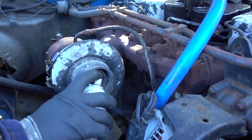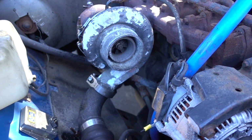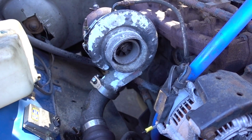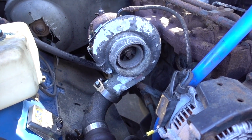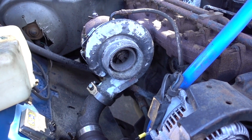We're gonna swap the turbo on John's truck because we do think it is the seals inside. The wheel's tight, but we think that, did we explain this already or no? I don't think we did. No. I think the seals are shot inside, creating some possible blow-by situation under boost. So we are going to swap the 351 on here.